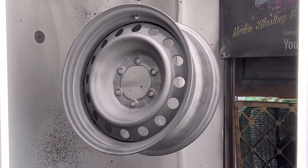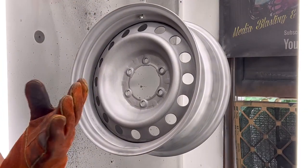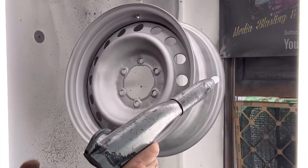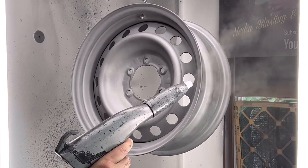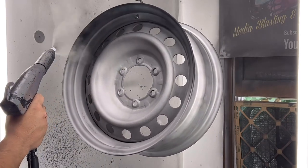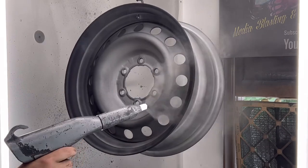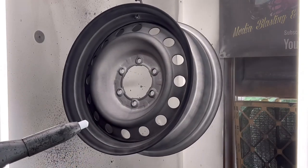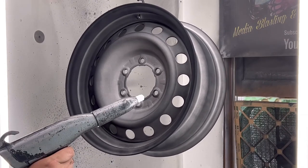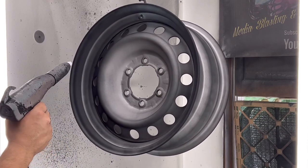Okay, guys. So if you get too much powder, you're gonna get a block and you'll get drips. So aim away, do your initial pull, make sure you're not getting a burst, we're not. I'm gonna go on the outside, get my lip. This way I know I'm controlling my powder and I know what I need, and to me that's too much still. And that's why we kind of do the outside lip first. Okay, this is good. See how it's barely anything? That's what you want to do